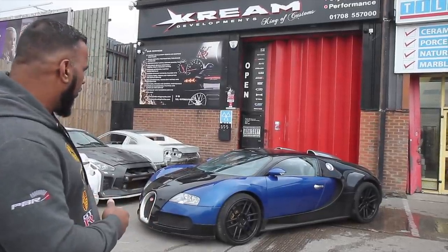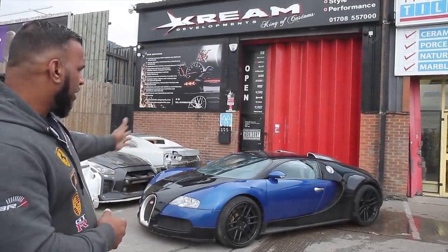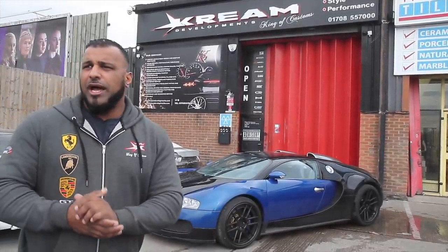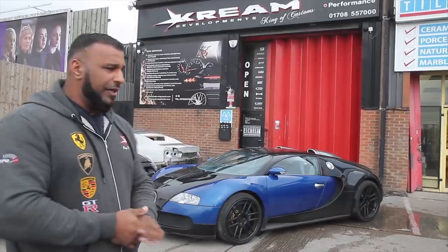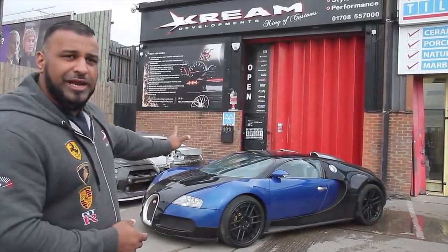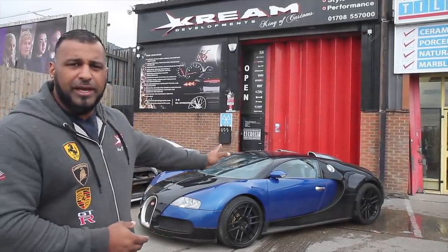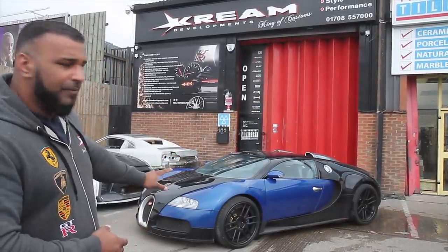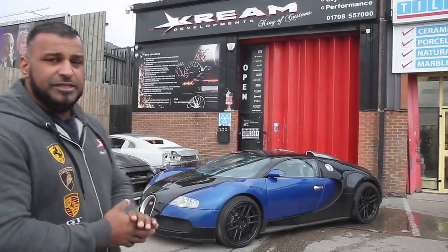We are planning on painting the whole front end and the entire bonnet, bringing the paintwork and ending it right by the door. The colour match should be spot on, because thankfully there isn't really any need to bring the paint any further back, because the stone chips are predominantly around the headlight area and the front bumper, and mainly on the bonnet. So yeah, happy days.